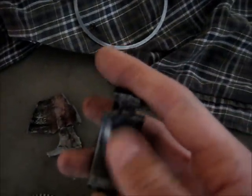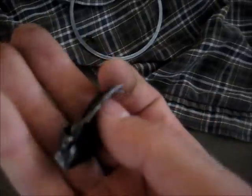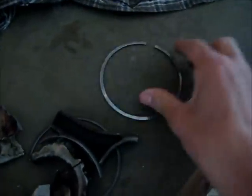More conrod, had some hot spots where the bearing spun and just cooked it, because when the bearing spins it just burns and scores everything. Part of the actual bearing itself just got worn down to nothing, and that got extremely hot. You can see just how discoloured it is. More piston. Little tiny fragment of bearing there. That ring there's nearly perfect. The only thing that survived was that ring.